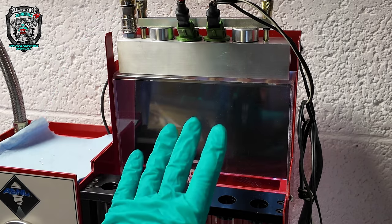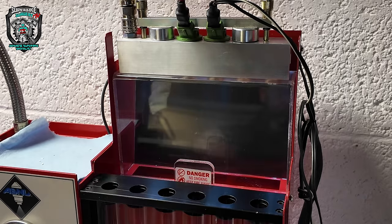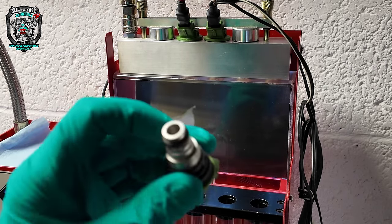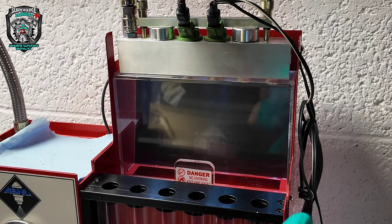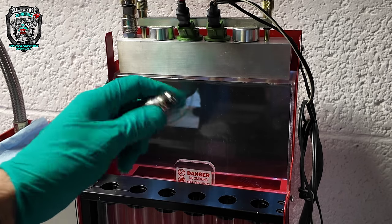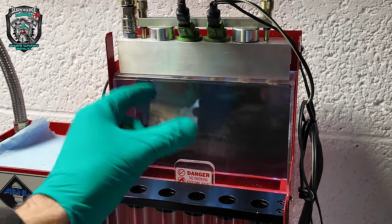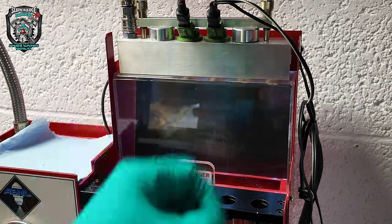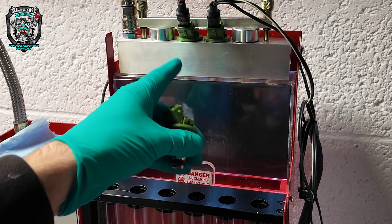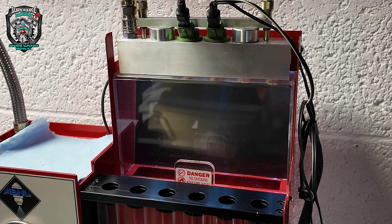I've got a YouTube short I made servicing some injectors out of a GSF1250, which were single hole injectors. There's a before and after - the before shows a couple of injectors with tiny little jets of fuel, and you'll see how the atomization was improved after the servicing process. Let me play you that now so you've got an idea of why I've got an issue with these as they are.